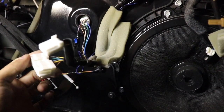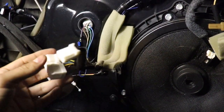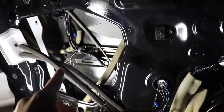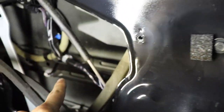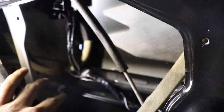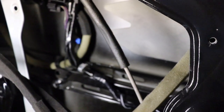Do not test the lights until you put your door panel back on and connect the harness. If you don't, your lights will not function properly. Once you do, you should be good to go unless you actually did something wrong. One last thing: make sure you keep the wires that you tuck through the grommet tucked along with the harness — tape or zip tie them — because you definitely want them out of the window rail so they don't get cut when you lower your window.